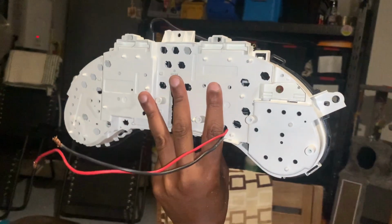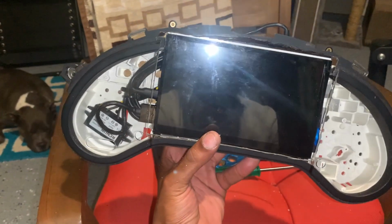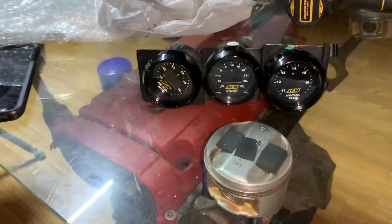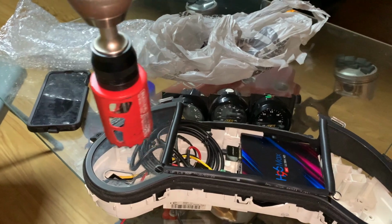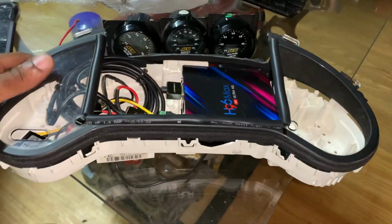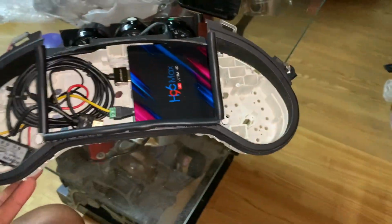It's nothing. Just ran the two wires through. Nothing protruding. But yeah, that's how she sits. See if I can show you the finished product once it's in the car, but for right now, that's it. So that's my old gauge pod, and since I'm putting it inside of this screen, I'm just gonna use my hole saw. Drill a hole here, drill a hole here, take it off and paint it, and put the two gauges in here. The top piece actually broke off, but I don't need it because there's more supports on the back. So this part will be hidden under the dash part. But let me take care of this and I'll be back with you guys in a second.